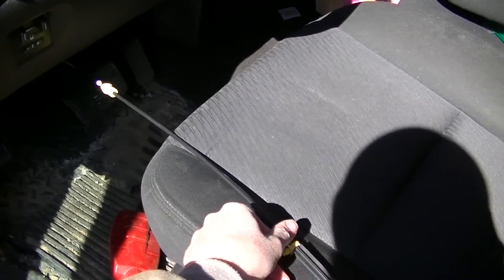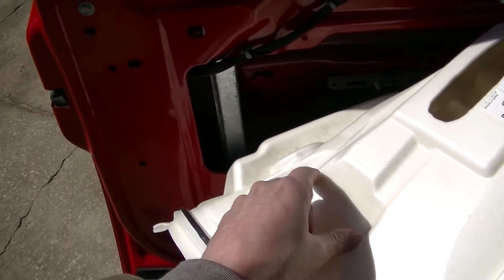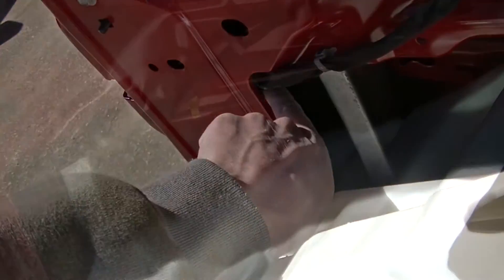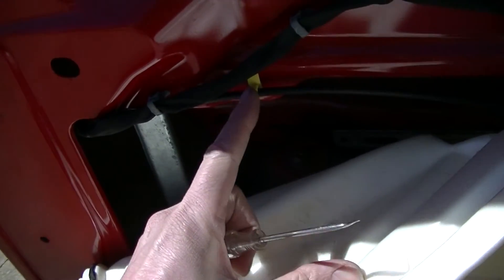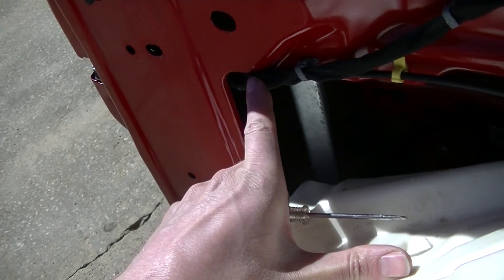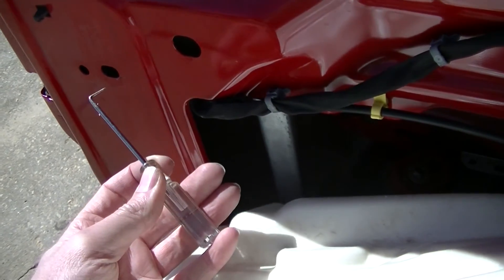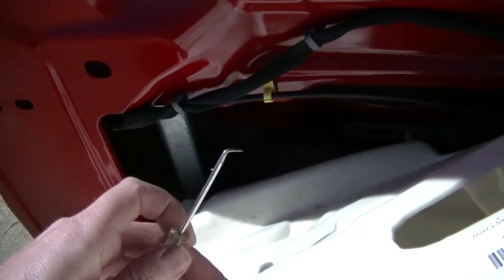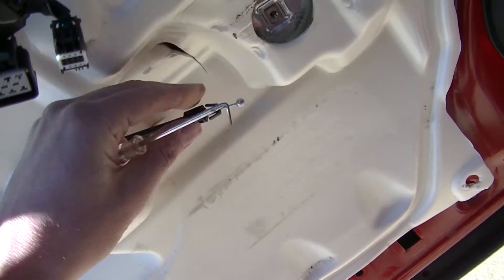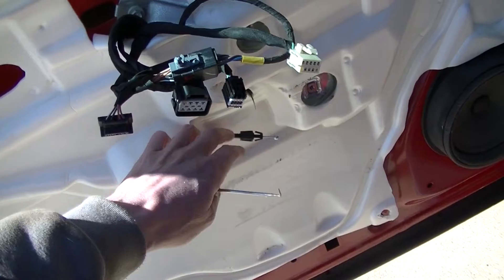To replace the cable, you're going to need to get inside the door panel. To do that you've got to pull the insulation back and go in there — I can't get a camera in there, I can barely see it myself. I got my cable in there with the little clip attaching it to the inside of the door. First I snapped it into the mounting hole, then ran the little ball up over the latch. It comes out right here and everything is working out. Next, get your door panel back up, get the cable hooked up, and snap the door panel back on.